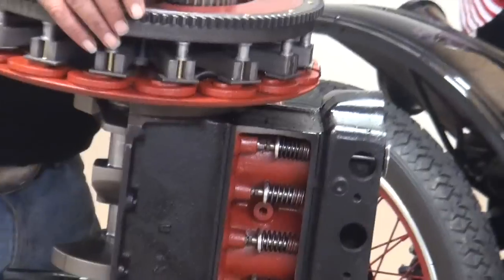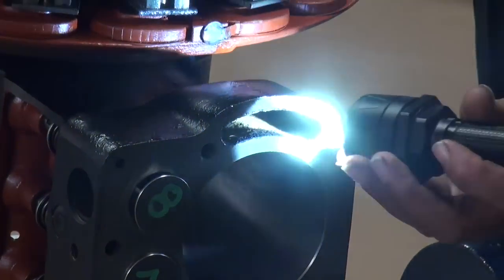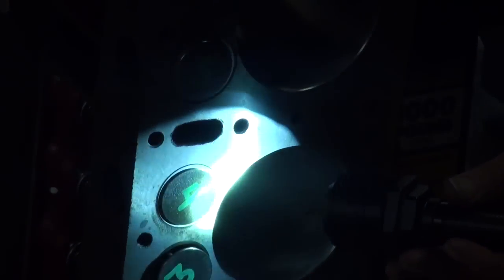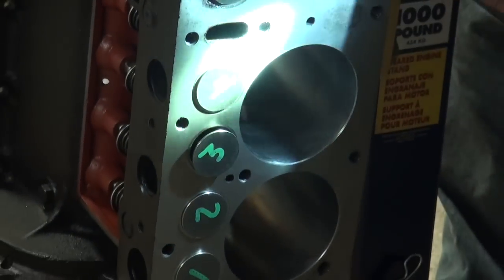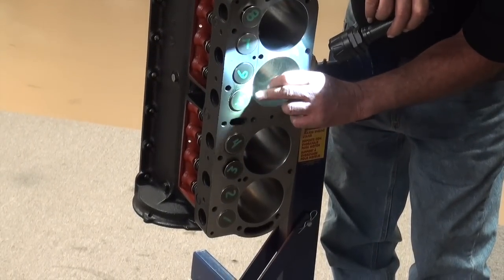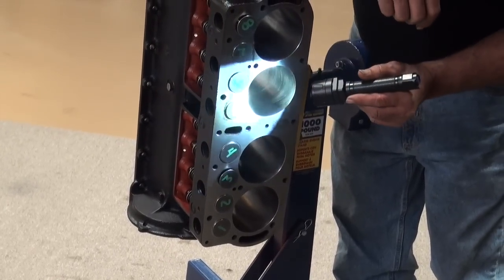On the other side where the cylinders are, you'll sometimes find some little spider cracks that migrate towards the cylinders. You'll also want to take a look at the water jacket itself where the head goes on, make sure you don't have any cracks in that area. Sometimes I see where they've cracked out and split in between the water jacket and the head bolts. Another area to check to make sure we don't have any issues or cracks is in the valve guides. On the later blocks with the single valve cover, it's not uncommon to see a crack in the exhaust valves between two and three. You want to take a look at that.